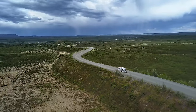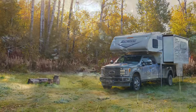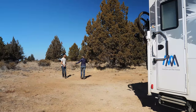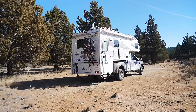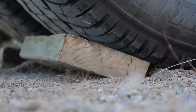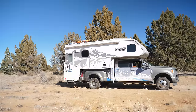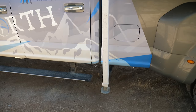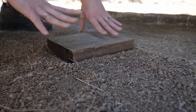We're going to start assuming that the truck camper is already on the truck. The first thing we need to do is find our campsite — the more level the better. While truck campers can be leveled once off the truck, having a dip under one of the legs or having to level it too much puts additional stress on the camper, so we prefer to level the truck before taking it off. When selecting your spot, be cognizant of where the jacks are going to land — make sure they're not in a big hole or have a big rock underneath them.